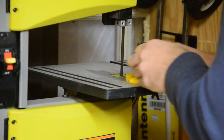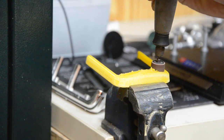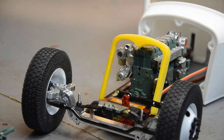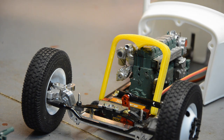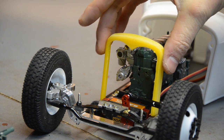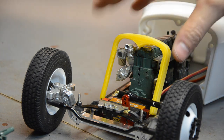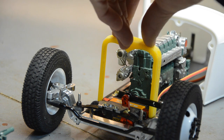This is what we're looking at now. Sitting here debating how to mount it — I had an idea to braze some little metal plates, but honestly that's a lot of work for little result. I was thinking I've got the upper mount for the servo, the upper screw that goes through the servo mounts, and I could just run a longer bolt through there and attach a plate across using those somehow, then use some scale hardware to attach it to the grill.